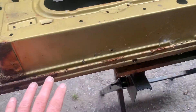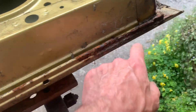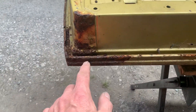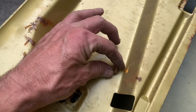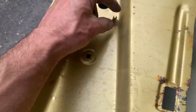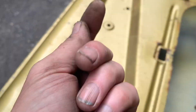This door's pretty knackered — you'll see that these are the drain holes along the bottom here and they normally get clogged up with rust, which is why the doors rust at the corners, and there's not much to salvage on this door. These little pieces here, if you need to take them out, they just twist and pull straight up. They'll be useful to somebody who has cracked theirs or lost theirs.